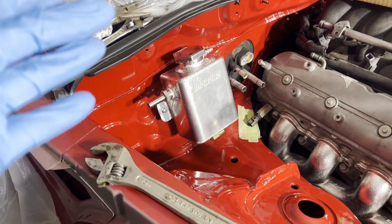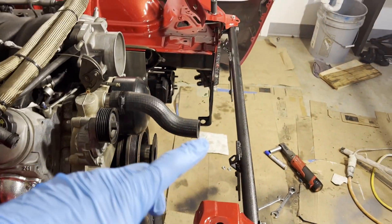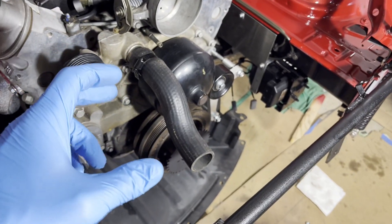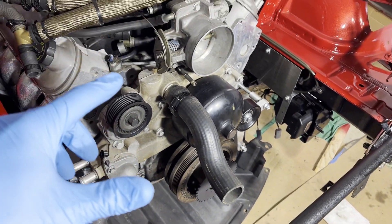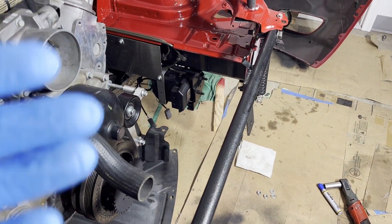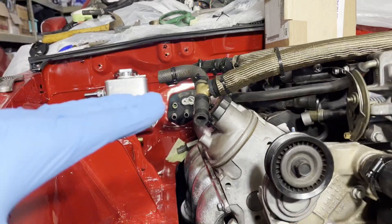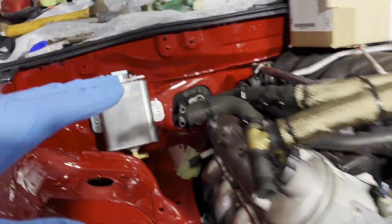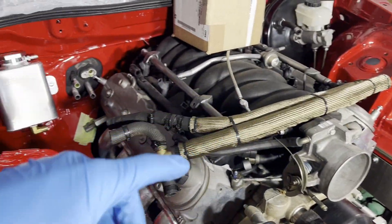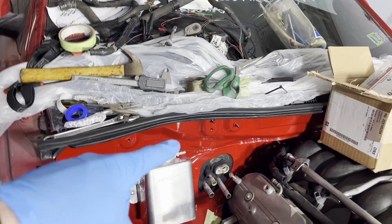If you're not aware of what the expansion tank's for — I'm using a stock version of the RX8 radiator which doesn't have a cap on it. That is because the radiator sits lower than the engine with the stock rotary, so if it's not at the highest point you can't put the cap and fill it there because it won't bleed. Whenever you're mounting the expansion tank you want the cap to be up higher than the tallest point of the engine, or the highest point of where coolant flows through the engine. Where I'm at here I'm up above, which means I can fill it and bleed it back here no problem.